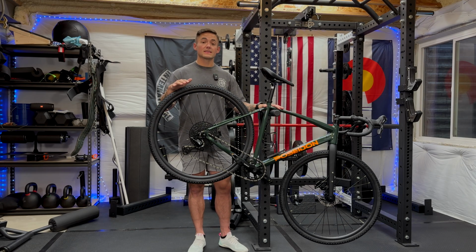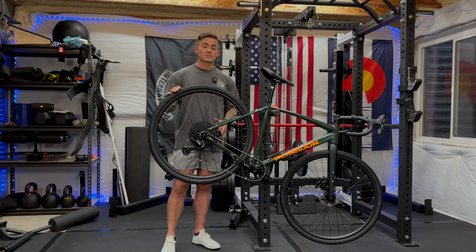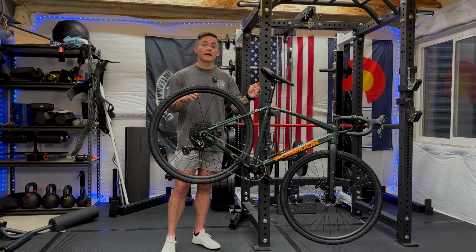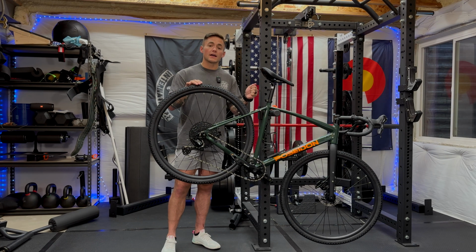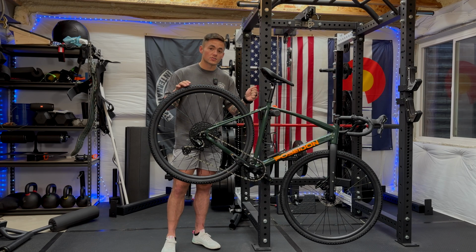And so if you're running into the same issue, one hack I stumbled upon when I was YouTubing this is to loosen up the housing bolts on the caliper assembly itself. And then you're going to squeeze that brake down and hold on to it. And this should center the caliper assembly again. And then you'll tighten back down those housing bolts while you're still holding onto the brake. And that shored things up pretty well for me.